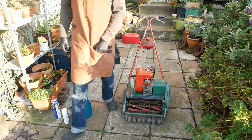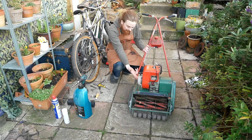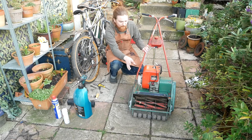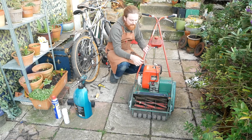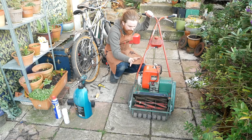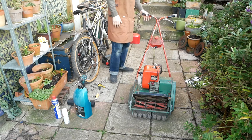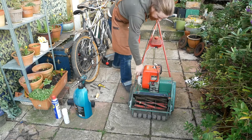Rethink. I've double-checked the points and moved them a little bit closer together — I think when I tightened the lock screw they may have moved apart and the gap wasn't perfect. I've cleaned them a bit more and fiddled with the spark plug. There's definitely fuel getting into the cylinder, so I'm pretty sure we weren't getting spark. Hopefully those points adjustments have helped. I've also learned you have to really twist the fuel tap all the way. Let's have another go.